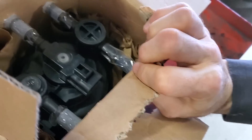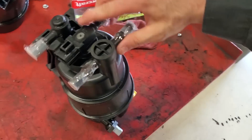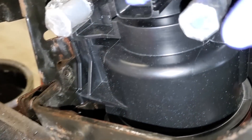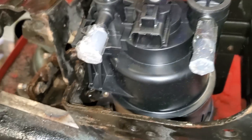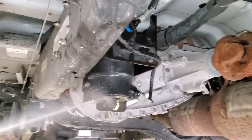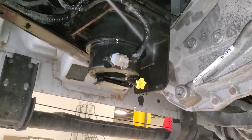Alright, I opened the box on the new one and one of these bloody ports was broken off, so I had to go back to the parts store, get a new one, and bring it back. Alright, everything looks good. Let's get this boy reinstalled. Remember what I was telling you about getting those feet in there — see those feet right there? There's two on each side. Once you get them all in there, it's basically just hit it down until it's fully engaged. Fuel pump down. Fuel pump is in, lines are clipped in. Let's give it a little look — make sure she looks clean. Get her on the ground.